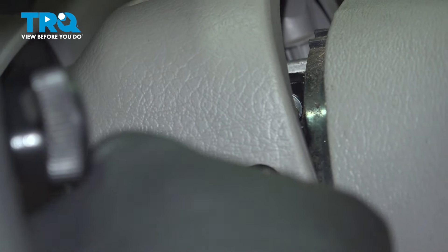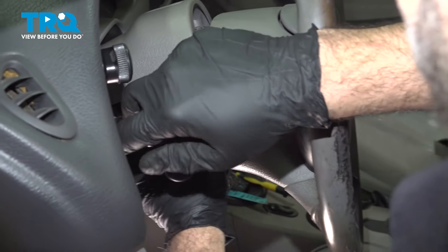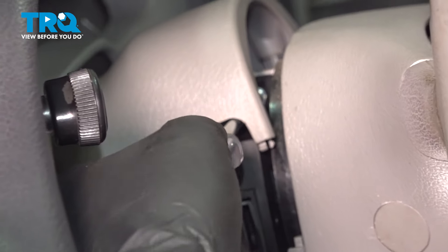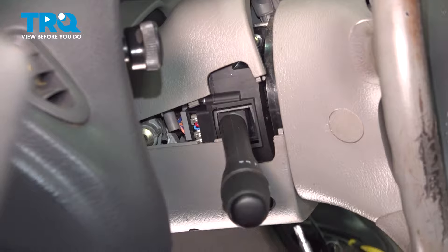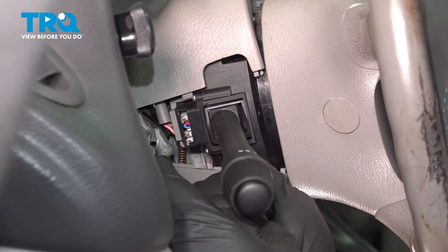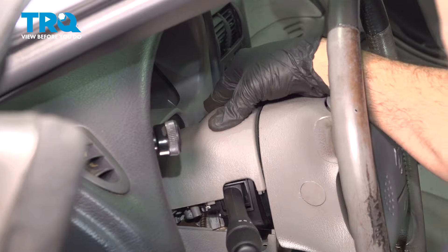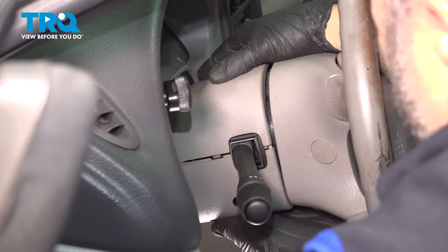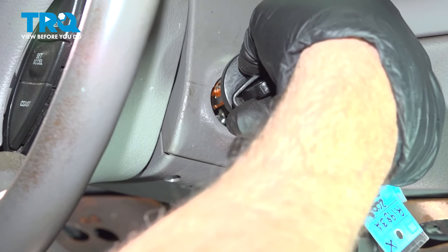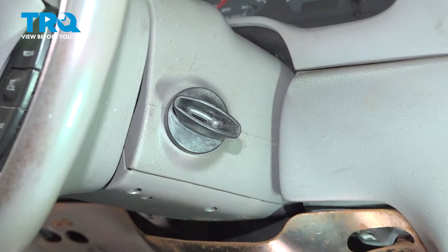Feed the upper screw in. Move the switch over just a little bit to get it lined up and get that screw started. Once you get the upper one started, snug that down, then go back to the bottom one and snug that down as well. When tightening, snug it and then back it off just a little — make sure this still has some room to adjust. Pull the upper cover over and pop it down, then bring the upper cover into place. Install your ignition switch with the button facing down, push it in, turn the key back, and remove the key.